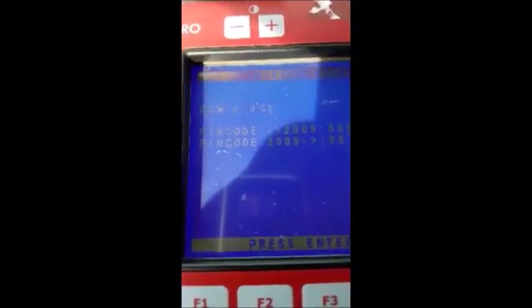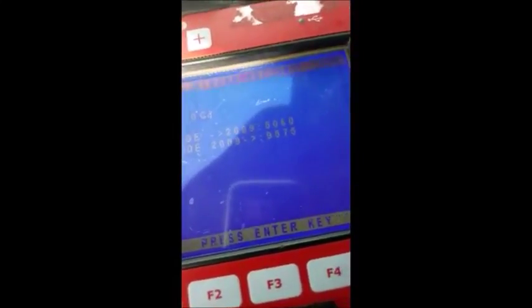So this is an 07. It's going to use the pre-2009 conversion, which is going to be 5060. The only reason I could see if it ever would on an 07 use a newer code series, the newer conversion number would be is if the dealer has ever replaced the BCM with a new one made today, it will actually use the new number. But being the original vehicle, 07 is definitely going to use the pre-2009 pin code.